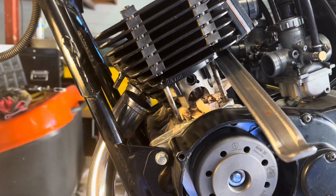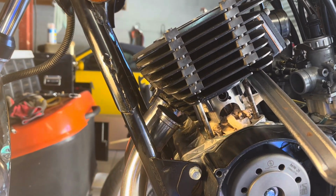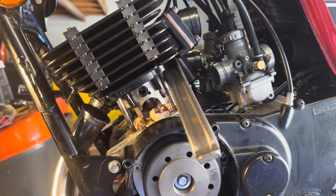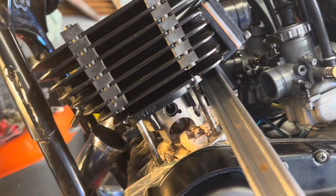just to see if I can hear anything rattling. I'll start the engine if I have to, but it will be for the briefest of periods, given that these gudgeon pins have been in and out and the circlips have been reused.